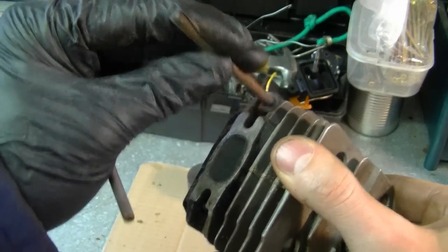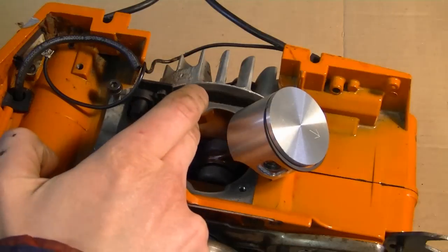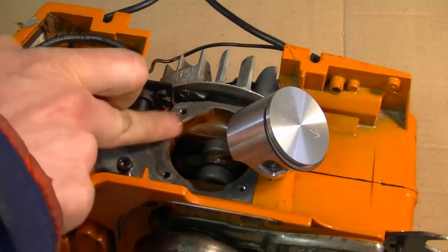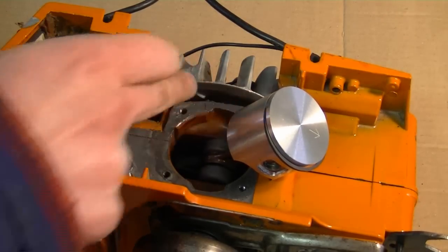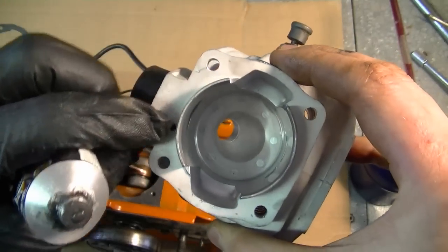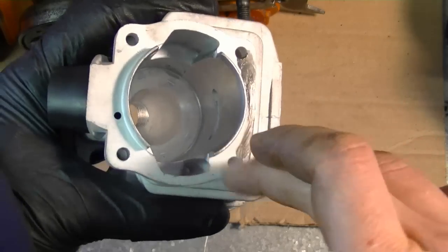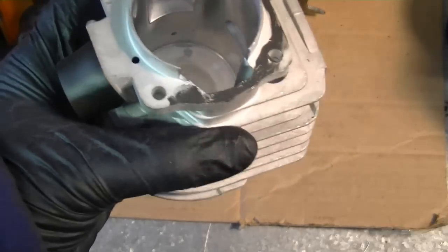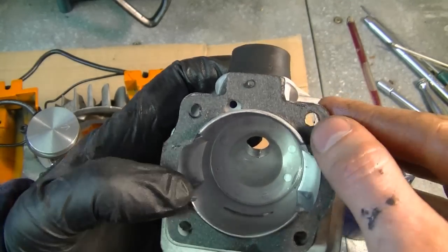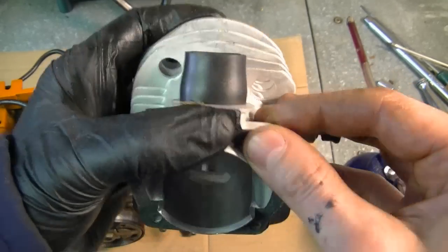If the exhaust bolts are still on the old cylinder, just remove them. Next I'm going to apply a small layer of RTV silicone at the base of the crankcase — just put a nice thin layer like that. You don't need to put much because we're putting in a new gasket as well. This is just to make double sure we have no leaks. Make sure none gets inside the crankcase. I'm also going to put a small layer of RTV silicone at the base of the cylinder — make sure you do not get any silicone in the impulse air hole. Once you've applied the silicone, install your gasket and line up the holes. The RTV silicone will help keep the gasket in place and lined up with the holes when we insert the cylinder.